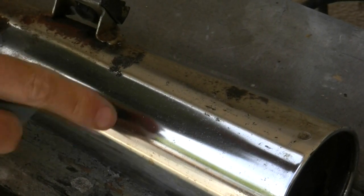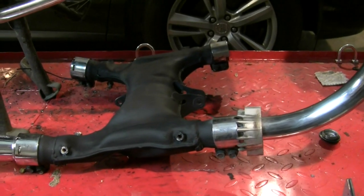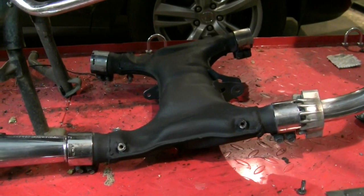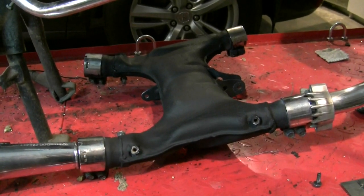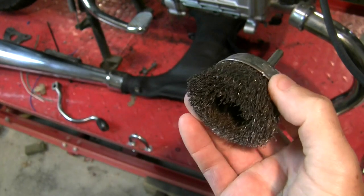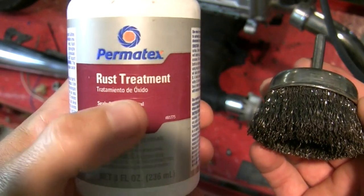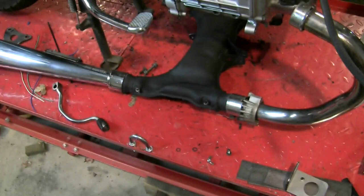Not perfect, but an improvement. Where it's pitted through the chrome, it just turns it black. One thing I've done off camera is paint this collector, or crossover tube, whatever you want to call it. I used VHT exhaust high-temp black paint — primer first. But also, I went over the whole thing before with a wire brush on my drill and removed a lot of rust that way, then finished it off with a rust treatment that converts the rust, and then did the priming and painting.